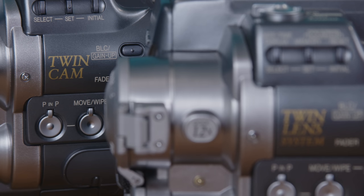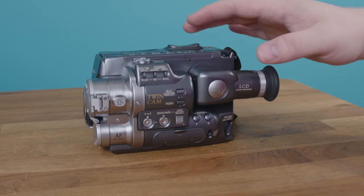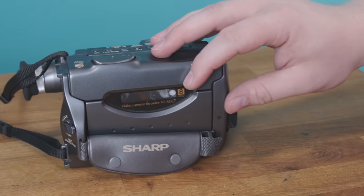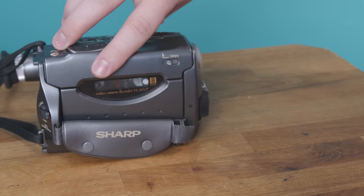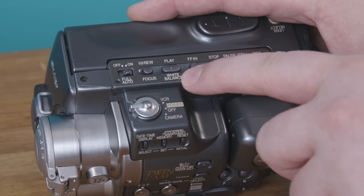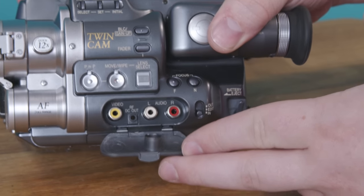Chintzy is the best word to describe my immediate thoughts when I first saw this device, and frankly my remaining thoughts even now. But I'll move on from insulting it for the moment so I can show you what it does, and then I'll finish insulting it later. If you didn't notice the twin lenses, the rest of the features make it look pretty much like any other camcorder of this era. It takes the extremely popular Video 8 format, which uses 8mm tapes, although this is Hi8 which was higher quality. It does have a color LCD viewfinder, which was a widely available mid-tier feature, and it has some other mid-tier features: automatic fades, manual focus, white balance control, shutter speed adjustment — nothing really spectacular. You can also set the AV jacks on the side to input instead of output, so you can use this as a full-fledged VCR, but that too was not terribly uncommon at this time.